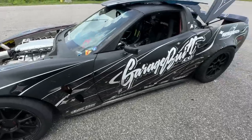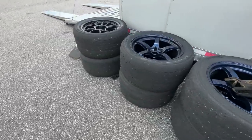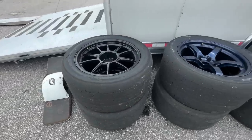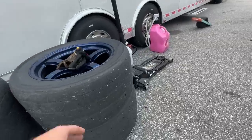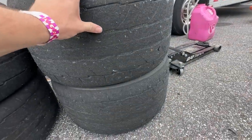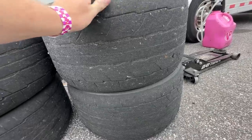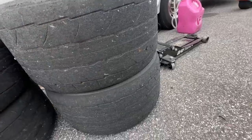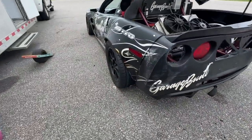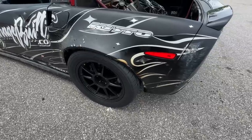All right, well, we've killed 3 scrub sets. They only last about a lap. They start to give up pretty much after the bank. So the car is quick on the bank, but a little slower after the bank. But this is one lap. But these were pretty smoked. I mean, these were not the best condition scrubs ever anyway. So now we've got a new set on. We're gonna run the same super low pressure, all the grip, and see what it do.